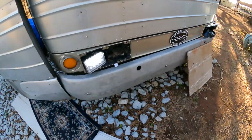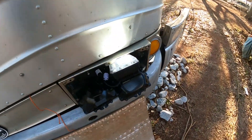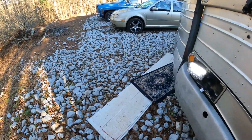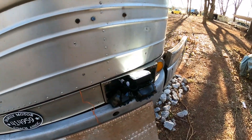So this should be high beam when I get back outside. Let's see if I've done it right. Had to rewire a bunch of stuff, but yep — looks like all of the lights are on. Looks like that's low beam. Now let's go back inside and bounce the high beam button down here on the floor. This is like the old cars used to be — you have the dimmer switches on the floor. Right there, see, we've got a big blue light. The big blue light indicates that we have high beams on. Let's walk back outside. Oh yeah — 1, 2, 3, 4, 5... 15 LEDs. 15 on each side.